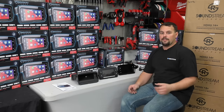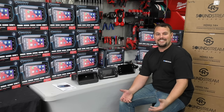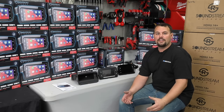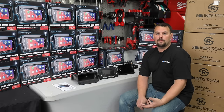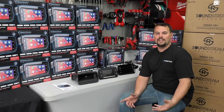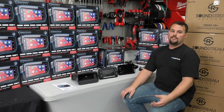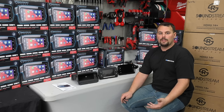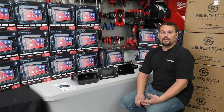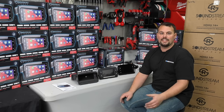First, let's talk about who this is meant for. If you have a GTS radio — 18, 19, 20, 21 Harley — and you've got the factory touchscreen, it has Apple CarPlay capability and Android Auto capability, but you have to have what's called a WIM installed or turned on to activate that. If you were to activate it through a CarPlay jumper, or even if you flashed your WIM and turned it on, you don't have the ability to use your voice assistant or make Bluetooth calls because you have no microphone, unless you have a wireless headset connected to it.